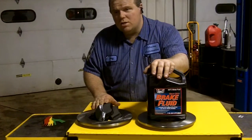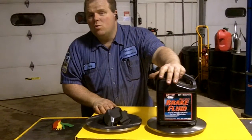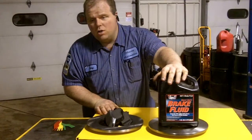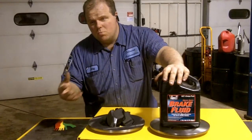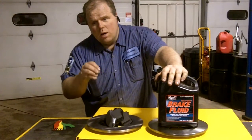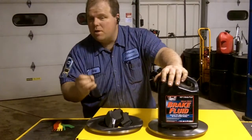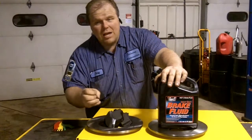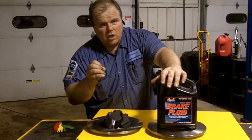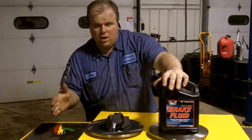The last quick thing I wanted to talk about is brake flushes. Not everyone is aware of it, but brake fluid absorbs moisture — it's what they call hygroscopic. What it does is it corrodes the internal metal parts: calipers, wheel cylinders, and yes, ABS controllers. Everybody likes ABS, but when the controllers get corroded and the valves hang up, that's when one wheel is hanging up.